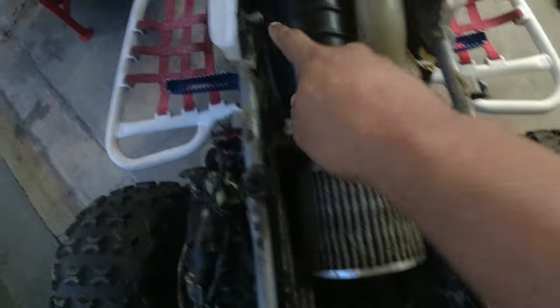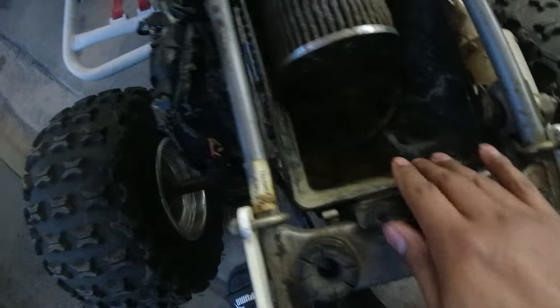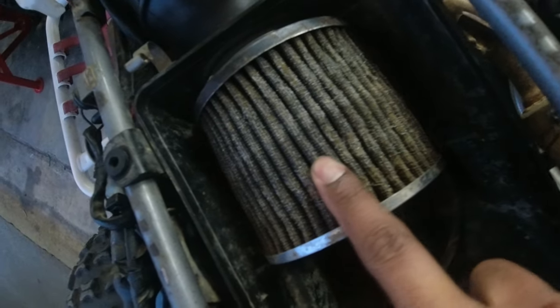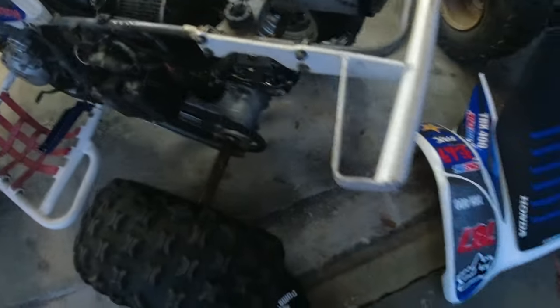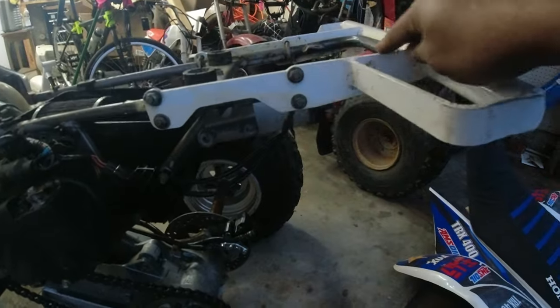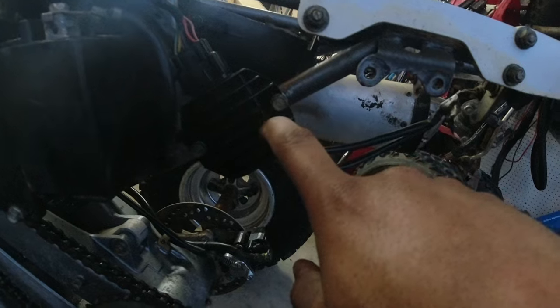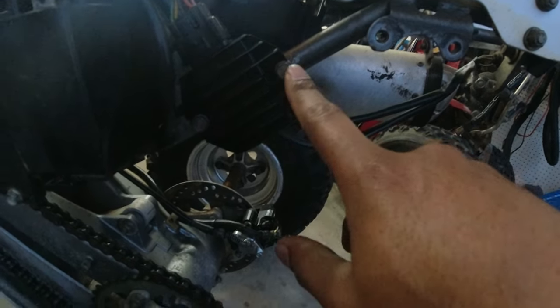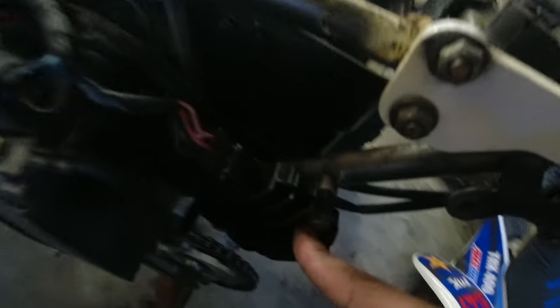It's also missing a seat grommet. The air filter lid is missing, and the filter itself looks like it was dropped into the bottom of a river and pulled back out. Surprisingly, even though this bike was popping wheelies, the rear of the frame is only angled up just a tad — I was very surprised by that. It looks like the CDI was replaced at some point, but I can't tell if it's a stock replacement or a performance unit with a higher rev limit, since it has no markings on it.